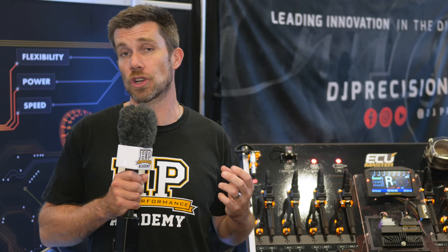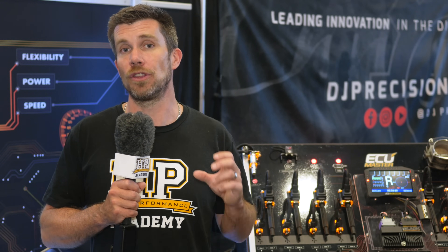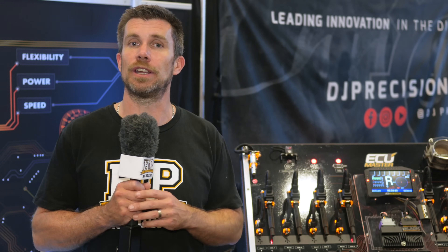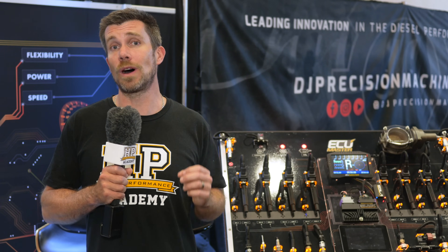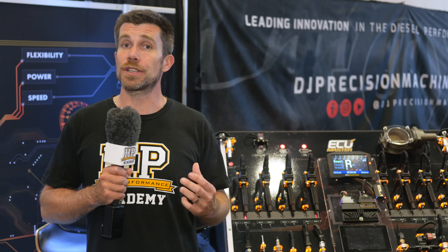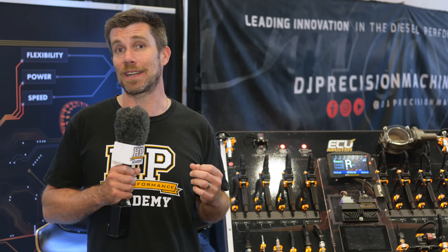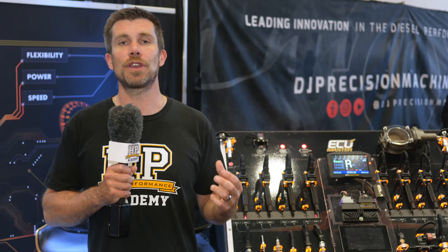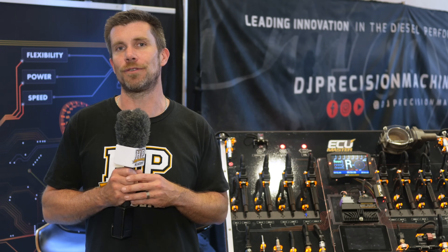This is a really nice way of adding the ability for the driver to easily control any of the functions or channels in the PMU via a keypad that can be fitted in the dash of the car. These keypads are available in 4, 6, and 12 key variants. The icon beneath each button can easily be swapped out, with a huge range available to cover most of the common functions these buttons would be used for.